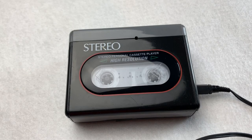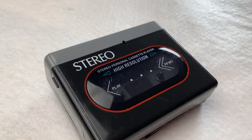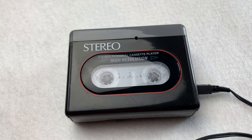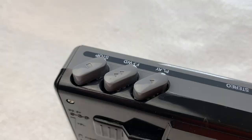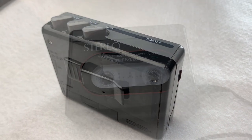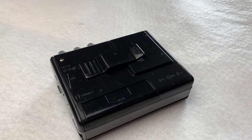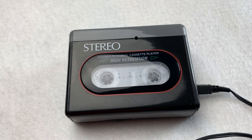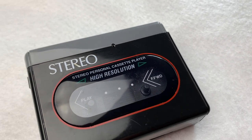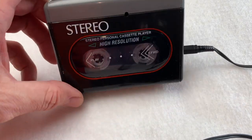So here it is then — the personal stereo that doesn't speak its own name. I still don't quite know what it is, or where it's from, or who makes it. If you know, please let me know in the comments and enlighten me. I've seen a few of these around on eBay, sometimes on their own or occasionally as part of a job lot. I hoped you've enjoyed having a look around. Dead easy to work on — it just didn't have any drive, and was sticky and grimy. We've given it a hygienic clean and polish, changed both belts, cleaned the head, capstan and pinch roller, and adjusted the tape speed. Two little screws holding the whole thing together and the mech just comes out. The actual build quality leaves a bit to be desired, and it's not exactly high in functions either.